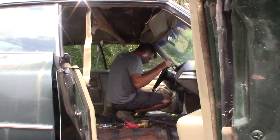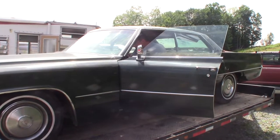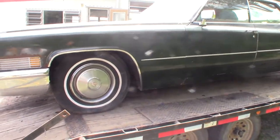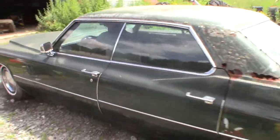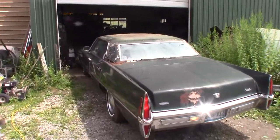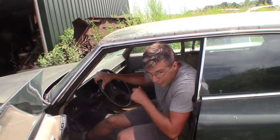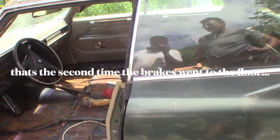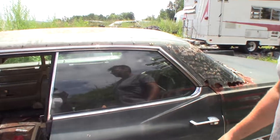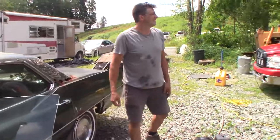The booster is sticking - that's probably all that was wrong with it. We let it run for about 10 minutes and it's sounding better, idling nicely. But looks like the brakes aren't working. The brakes went to the floor and stayed there. All right, we know that needs work. We've got the rat-a-lac running though. It could have been a disaster, but I'm just glad it's off the trailer now.